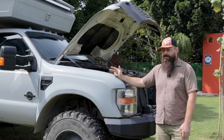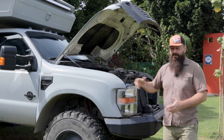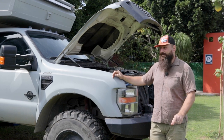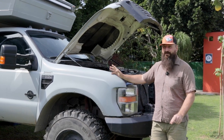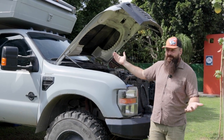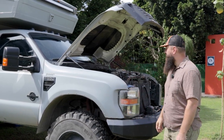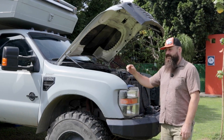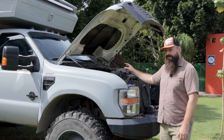The first thing to check, of course, is that you're not leaking exhaust before the turbo. Normally you would just do a brake stand, put it on a super race tune that's super smoky, and if you've got smoke billowing out by the turbo, then clearly you've got a pre-turbo exhaust leak. That's difficult for us to do because it's a manual, so they suggested putting a camera and a flashlight under the hood and taking it for a rip. So we did that, and fortunately for us, no smoke. So I'd already had those connections all tight pre-turbo.